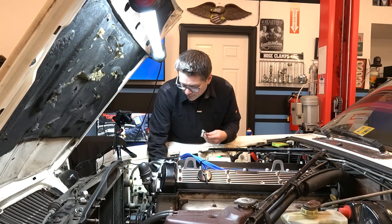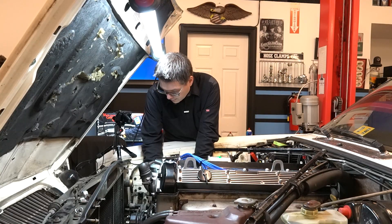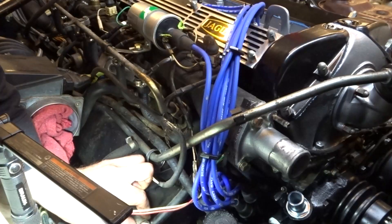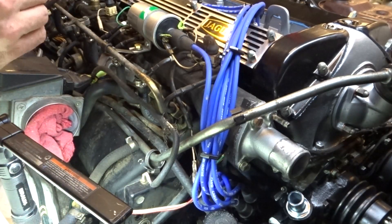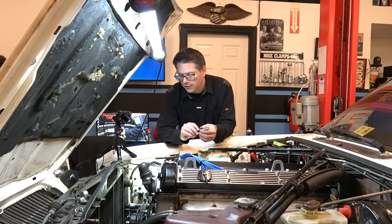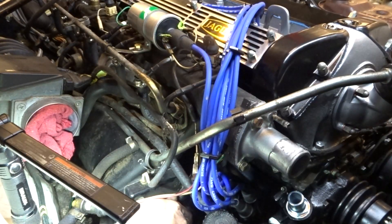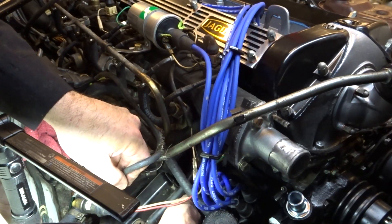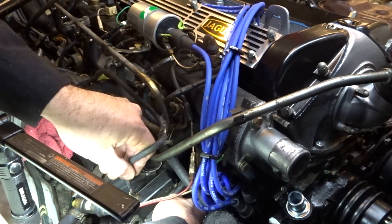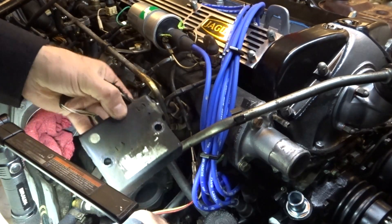It's pretty simple about how it's held on. On this side we do have a fuel line that is cinched on, so when we take this off it looks like there's a spacer. The ignition amp is fairly easy to remove — two bolts hold it on, with one of them having a spacer and a fuel line mount. Then it's just the wiring harness to the coil and the plug on the backside that goes to the distributor. As you saw, that plug going to the distributor is probably extremely fragile from years of heat. We'll give you some details on sourcing a replacement shortly.